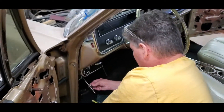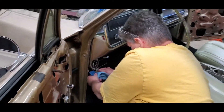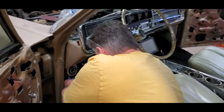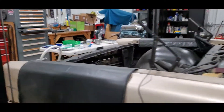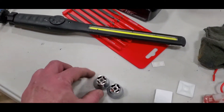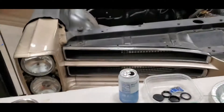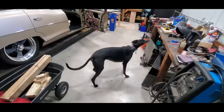Those don't come off as easy as we'd hoped, and of course the new aftermarket ones don't fit - they're drilled too big. So we're gonna have to fill them with some epoxy. We're gonna get brackets mounted back up before we do that, because aftermarket garbage is garbage, it's just the way it is. The holes are drilled way too big for the interference fit so they just pop right on. We'll throw some PC-11 on them but we'll get them mounted first because this takes about a day to dry.